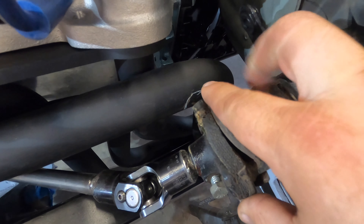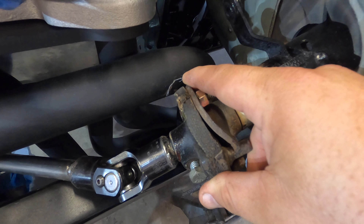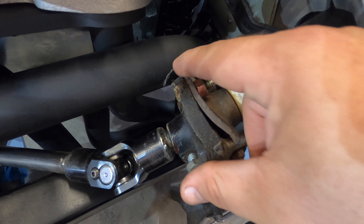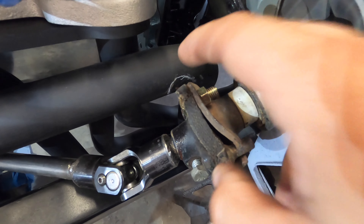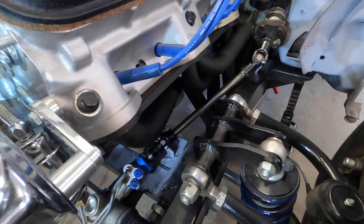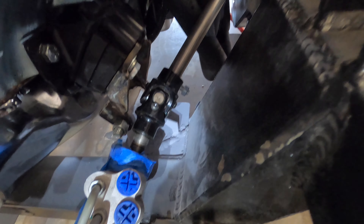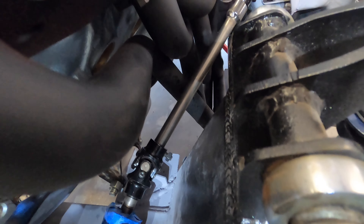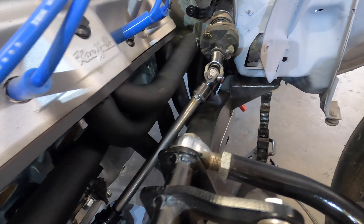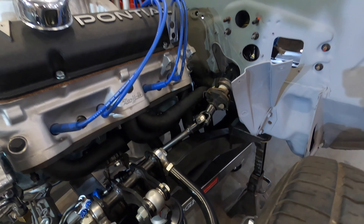That's how she turned out — just an update from last time. I'm very pleased with it. Right now it's a little wobbly like I said, but I've got that piece on order. There's also a spot right here where it almost barely rubs the header — I don't want to hit it with a hammer, so I think I'll put a little dimple there. The plan is to drill it out with a hole saw, flip it around so it has a little indention, weld it up, smooth it out, and get it coated. That was just a quick update on what I did with the steering.